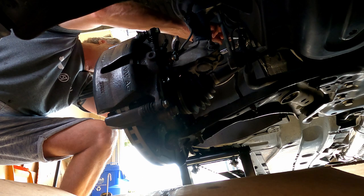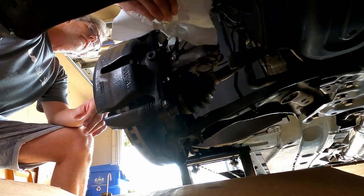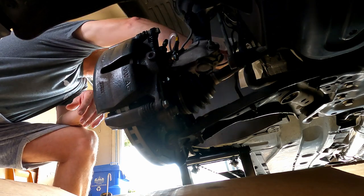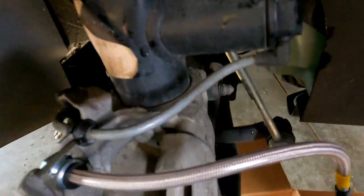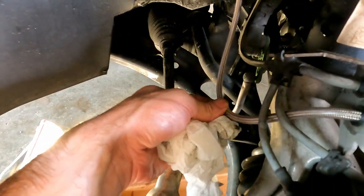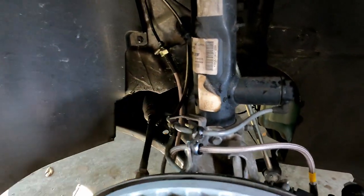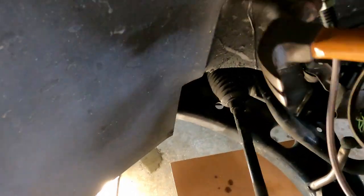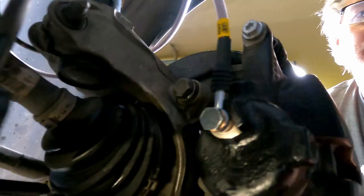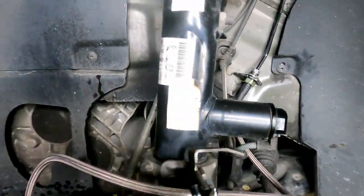Just get them tightened down snug with a little extra, and make sure they're not leaking when you do your testing. Wipe everything down — brake fluid is pretty corrosive. I have a cardboard box underneath to capture all the fluid and soak it up rather than letting it go on the ground. On the passenger side you can see how the brake hose runs underneath the other sensor wires — that's what's different from the driver's side. Put the retaining clips back in using a tiny hammer or the end of a screwdriver. If any brake fluid got on the rotors, clean that off.